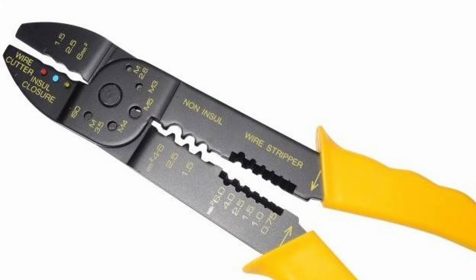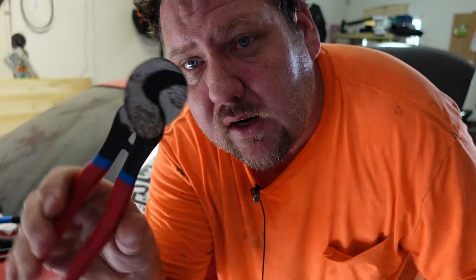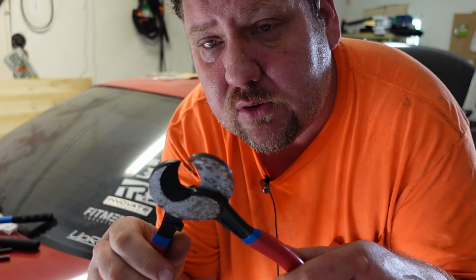Next are tools I use for wiring — I'll group a bunch together. First is a nice pair of dedicated wire strippers. Not the ones from Walmart or the cheap combo crimper-stripper — a dedicated set works a lot better. Next is a dedicated crimper, which works a lot better than those little flat skinny combination tools. For bigger wires you need different tools — these larger cutters are great for cutting bigger cables, and you can also strip them by clamping down and twisting. If you're adding an amplifier to the car you'll have bigger cables that need this.